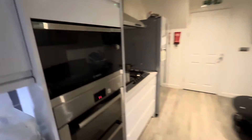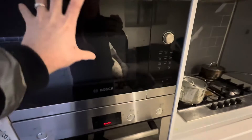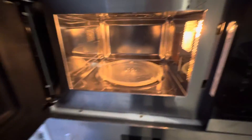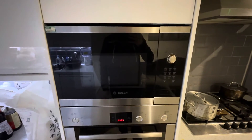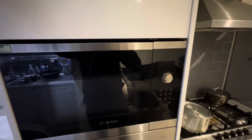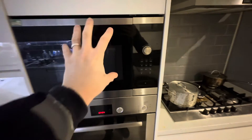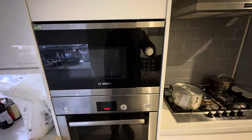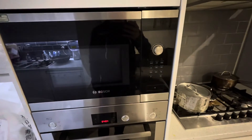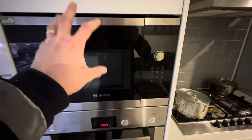The other quick one is you'll often see integrated items like this microwave here. It's not readily obvious that there are any screws on here — I've had a go and the thing is solid. There are a couple of screws in there, but there are some hidden around here. It's a microwave up at about four or five feet high. Someone's PAT tested it before, so go dig in and have a look in cupboards to see if you can find plugs anywhere behind. But something like that you may just have to do a visual inspection and say that the plug is inaccessible.